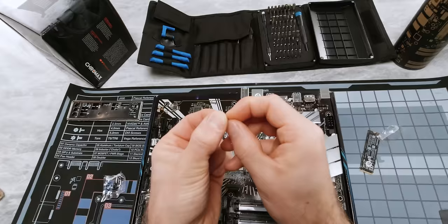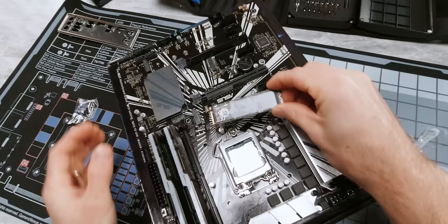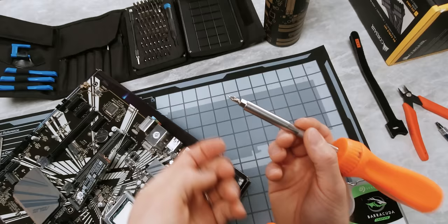And the other is a little tiny screw for securing the drive. You're unlikely to end up using a lot of force when you install your SSD, so just hand tight on this is fine. As for the drive itself, it installs just like laptop memory — you go up at an angle, push it into the slot, and then just hold it down in place while you're screwing it in. Something to watch out for here is that while most computer screws are size 2 Phillips, these are usually size 1, so you're probably going to need to change your bit before you finish installing.